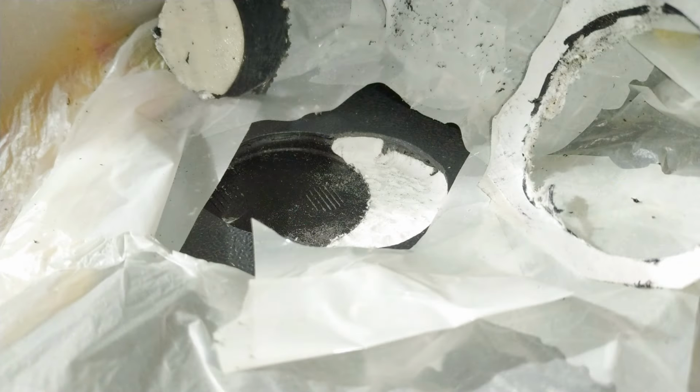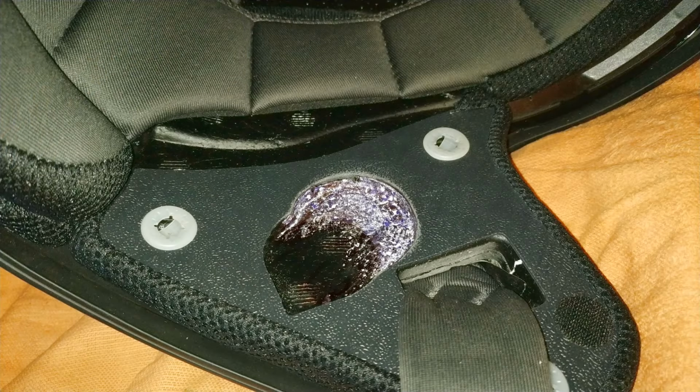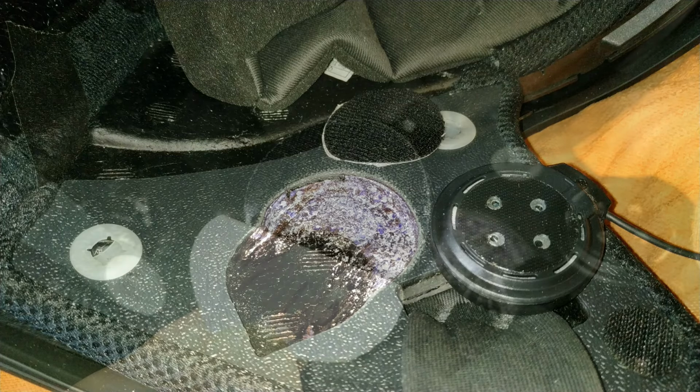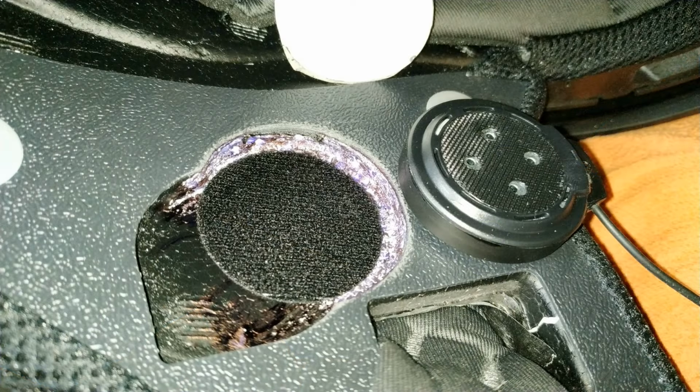Be careful. This kind of Velcro can be powerful. This means that it will be quite difficult to separate the pair, hooks and loops. However, various adjustments will be required many times during the installation and testing process of the headset. Therefore, take a piece of thin paper, make a hole in it, and use this element as a gasket between the mating parts. A thin paper gasket with a hole will allow you to easily remove and install the speaker.